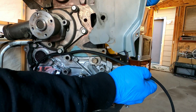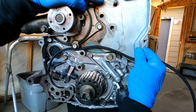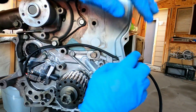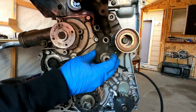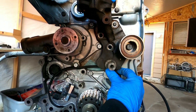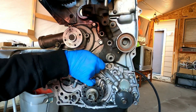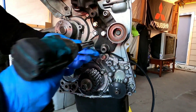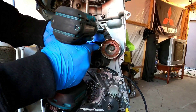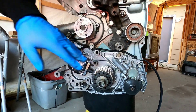We're going to slide this plate in first, placing the harness underneath. Then we're going to be installing the motor mount bracket — whether it's a 1G or 2G DSM — putting that back in. Just make sure nothing obstructs, especially this harness. Tuck the harness a little bit underneath the water pump and underneath this motor mount bracket, then go ahead and tighten it up. This is an easy way to install the harness without it obstructing anything.